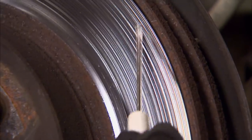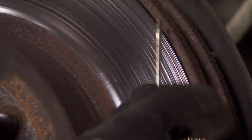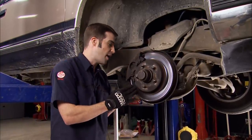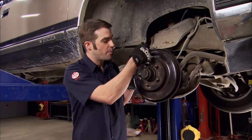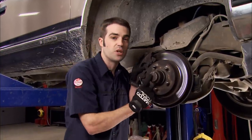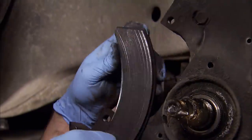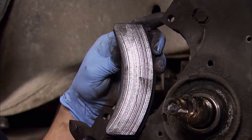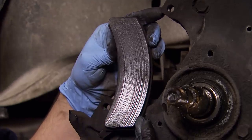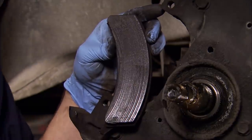This rotor's got more grooves in it than our camera guy Rob's favorite Bee Gees record. On the outer lip, it's pretty worn there too, meaning this rotor is probably well past its minimum thickness specification. The pads look like they're about half life left, but they're probably worn to match the grooves in the rotor, so we're going to be replacing both. Plus it'll give us a chance to adjust these wheel bearings. This brake pad is obviously wearing to match the rotor — the inside and outside edges are wearing on the lip as the pad eats into the face of the rotor, and the face of the pad is grooved just like the rotor.